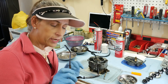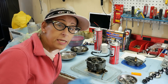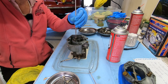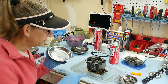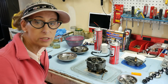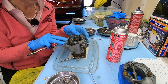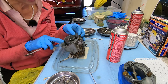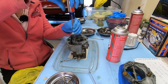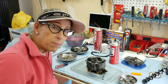I'm going to put on my safety glasses — it's a lot easier to see, and if anything sprays back up it'll protect my eyes. Let's continue with the air jets and emulsifier tubes at the top. There's a single screw holding this whole assembly in. I'm starting with a clean new dish for these parts because I like to keep parts that go together in the same dish — that way when reassembling I know what goes where. These air corrections: make sure they're the same. It looks like two 10s and one 40. The emulsifier tubes can be a little tight.